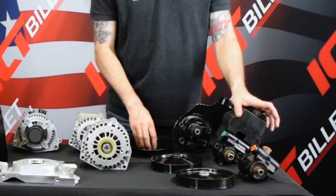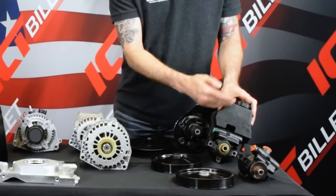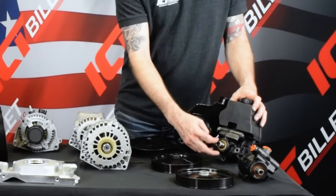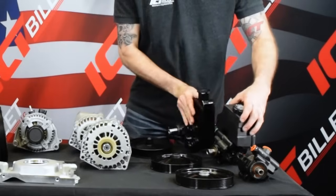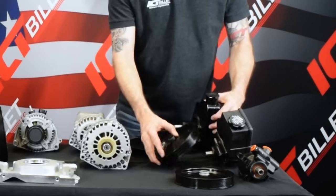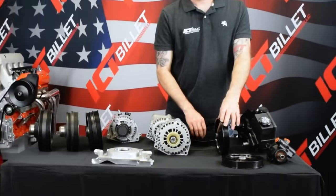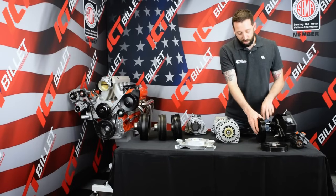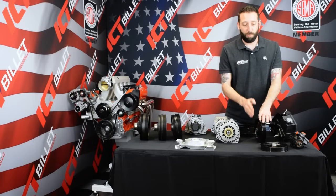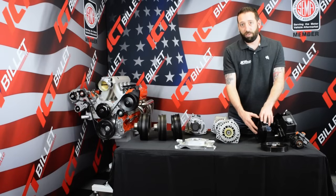The 98-02 Camaro power steering pump here is really popular, used on a lot of our brackets, because it's got the reservoir mounted to it, it fits the front of the head, and it looks good. This diameter is the same as the truck, but the projection is different — this one sticks out not that much, while the truck one kicks out quite a bit further. So these pulleys are not interchangeable. With any aftermarket Dorman pulleys, you might get them to fit, but the belt won't line up. Just assume you have to use the pulley that came with your power steering pump, otherwise it will cause your belt to be off slightly and throw the belt.